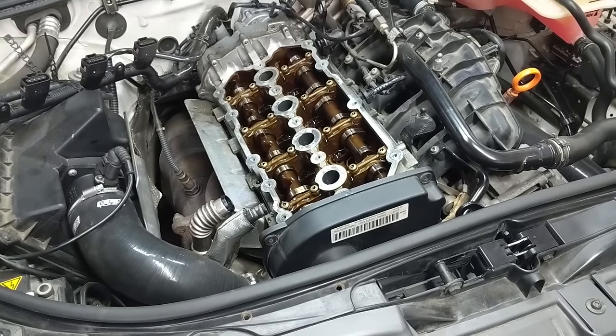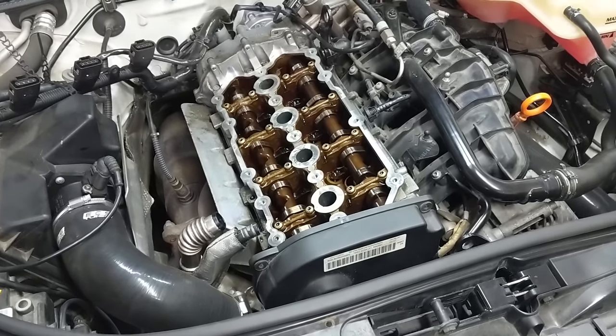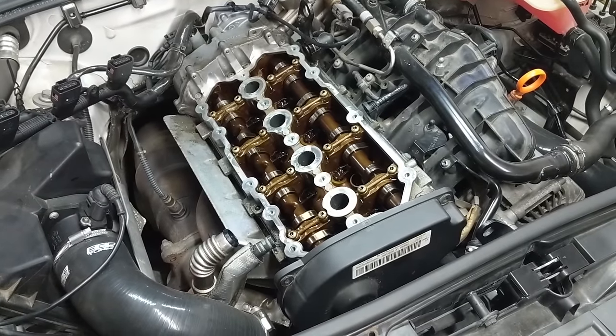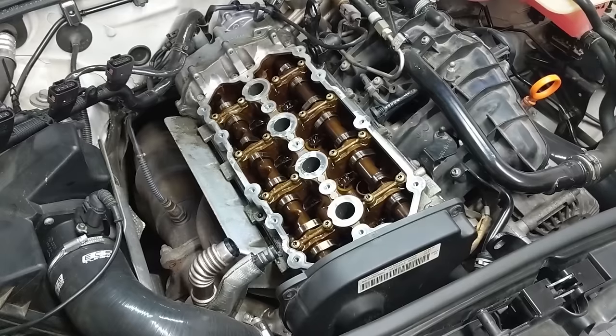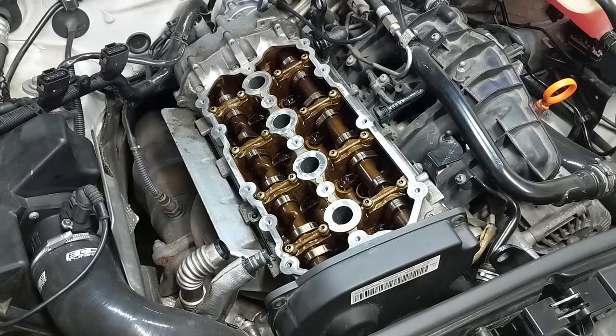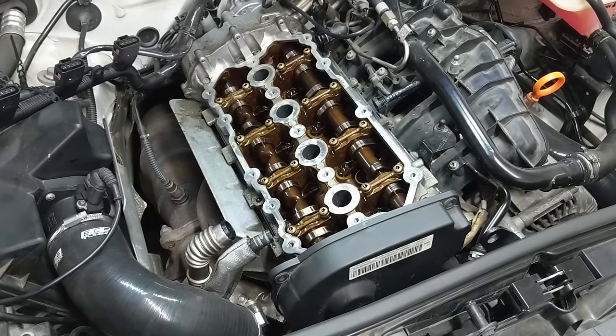Hopefully what we'll see in the results are that where the edge of the piston meets the cylinder wall, that area will be a little bit cleaner. All the scoping is complete — you saw cylinder 1 live and now looking on screen are the valves, piston faces, and walls of cylinders 2, 3, and 4. Generally speaking there's a lot of carbon buildup in all the same places across all cylinders. So a carbon cleaning is in my future, at which point I'll do another compression test. But for now we've got all our baselines, so let's get to work.